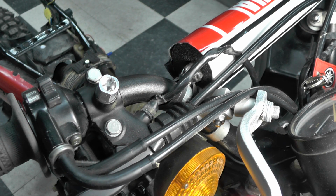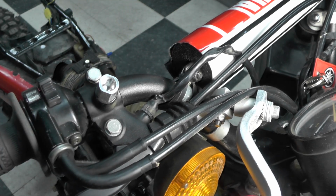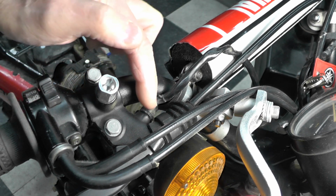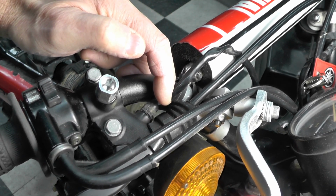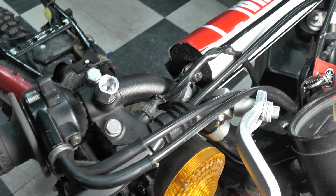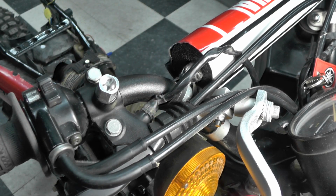And again, it worked. The brake light works from the front brake grip right here, handle, as well as the foot brake that I just demonstrated. So I'm not exactly sure what happened here, but for some reason this not being engaged all the way did not complete the circuit for either switch and didn't allow the brake light to work. When this was taken out of the circuit, the rear brake light switch would work. When I relocated this, which I believe is correct as it is now, the brake light started to work again. Whether this was out of service since they changed these handlebars, I don't know, possibly. But nonetheless, it's fixed. So everything he has asked me to do, that is horn, rear brake light, and getting it running, has really been accomplished.